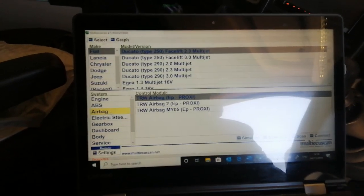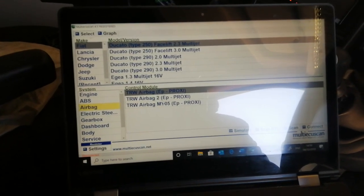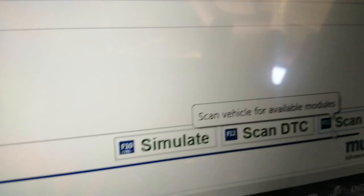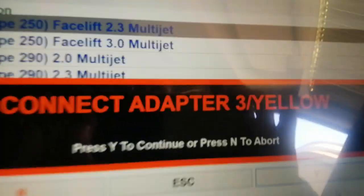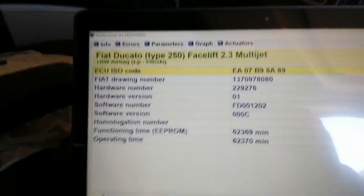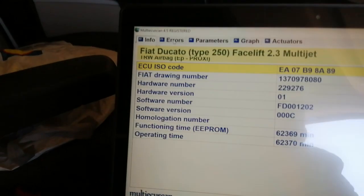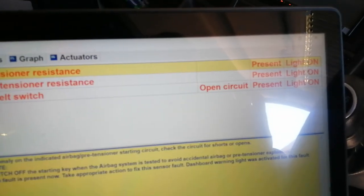So let's go and have a look at the airbag. Everything's ready. Click on airbag. I know that I've got the TRW airbag, not the Type 2 or the MY05 — you may have a different one. If you don't know, just hit scan and it'll tell you which modules are available. So I'm going to connect to the one I know I have. Connecting prompts you: have you got the yellow cable? Hit yes, and that's now connecting to the airbag ECU. There you go — that's connected. It's come up with basic information about the vehicle, and what we're interested in is this tab up here, which is the error codes.